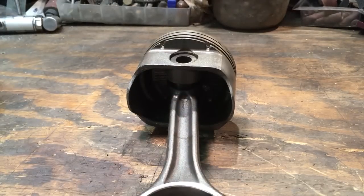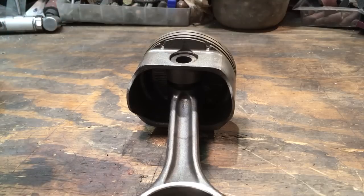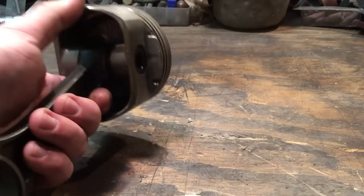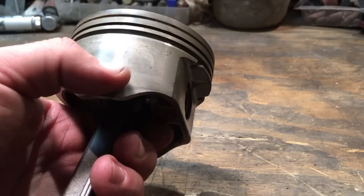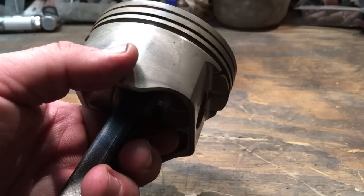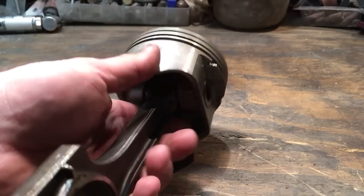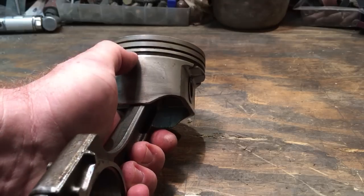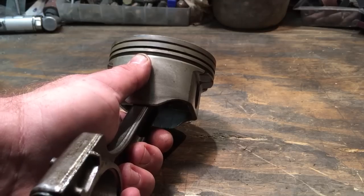In that article I read, it talked about adding two to three - I think they were saying three 32nds of an inch, but that would all be determined on how big your actual oil control ring land is - where you would add holes to the sides. Think of this as the piston on the crank: this is going to be your outside of the piston, the other side would be the inside, then you have your left and your right. What they're talking about doing is drilling holes in this ring land to alleviate that oil build up or any kind of a pressure issue from the oil not coming out fast enough.